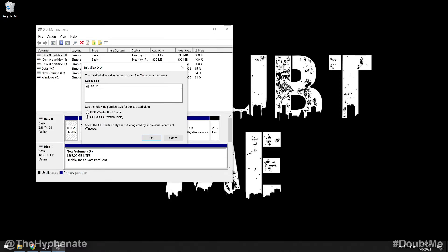You should get a pop-up that says 'Initialize Disk.' Depending on how many hard drives you've installed, you'll see them listed here. Since we have one new one, it says Disk 2 with a checkbox. Under that it says 'Use the following partition style for the selected disks' — use GPT. Go ahead and click OK.